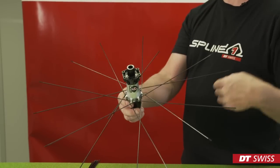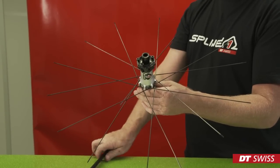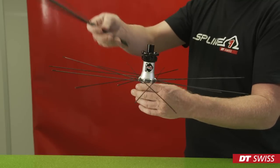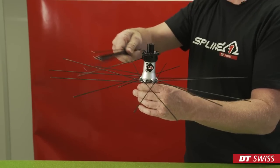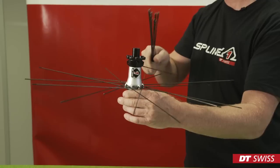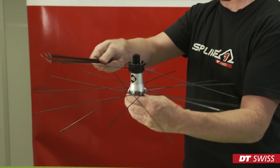When we have finished all the spokes on the first side of the wheel, we can turn over the hub and repeat everything on the second side. Turn the hub clockwise and make sure the new spokes follow the correct pattern. Take care to interweave all spokes.